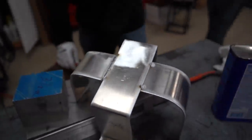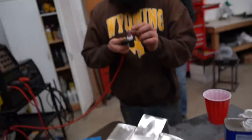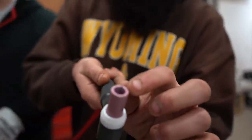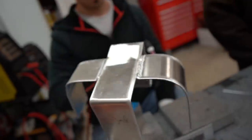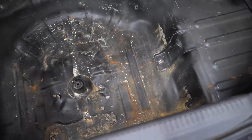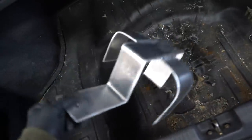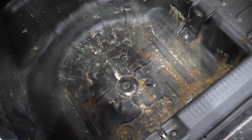There's some welding banter with Austin about technique - he dipped the tip in the puddle and messed up the weld. Our battery box is all finished up and good to go. Let's clean up this area a little bit - I'm gonna lay down some Dynamat so the battery is not resting right on bare metal, and maybe throw a little on the floor too so it doesn't bang around. Then we can get the battery bolted down.